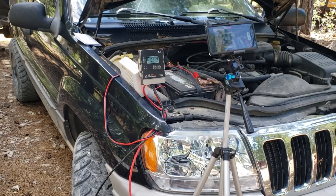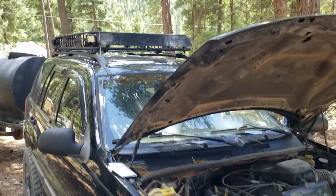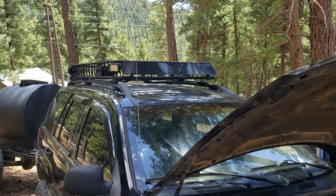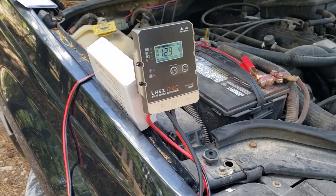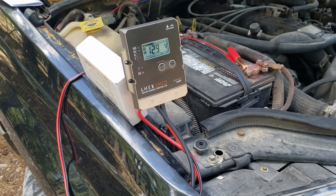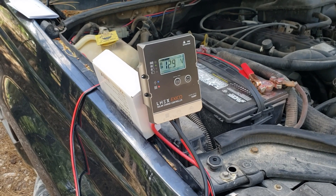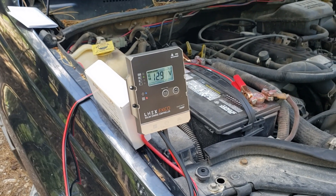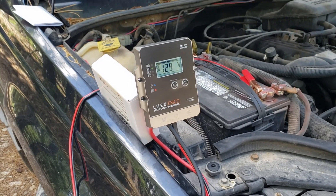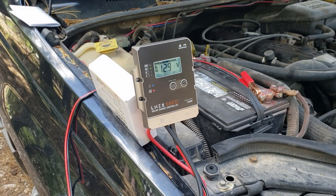You can use just a 100 watt panel — put it up on the roof rack of the Jeep, run some wires down into the cab, mount this unit permanently inside, and then run wiring to your battery with an inline fuse. This will pretty much just keep your battery topped off and charged every day it's in the sun. The charge controller makes sure it's not overcharged — which would damage the battery — so your car will always be ready to start no matter how long you store it.